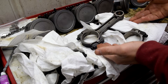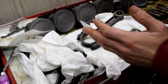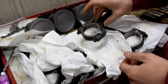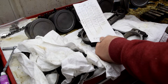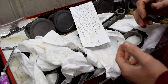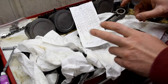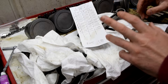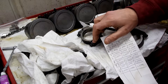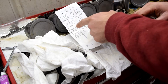With ARPs you do have the risk of a failing rod, a bent rod, or rod damage to the block. That's just my take. I was told to go with ARPs, I bought them, tested them, measured the results — take it for what you will. For this build — a 700 horsepower crank build, which is roughly 580 to the wheels — I'm using ARPs and not resizing them. They seem good to me.